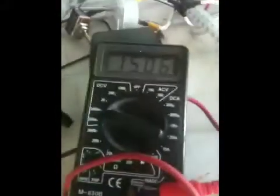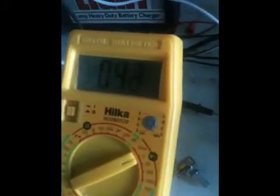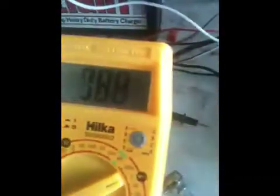Suppose this is fluctuating like an O2 output circuit would. We turn up the O2 enhancer — you can see as I turn it up, let's say 100 millivolts. You can see now it's 160, it's 104, 103 millivolts, 161. So an increase of 100 millivolts — we'll turn it up a bit more.